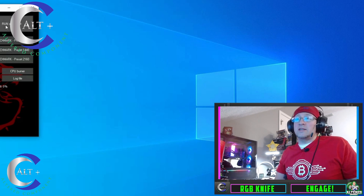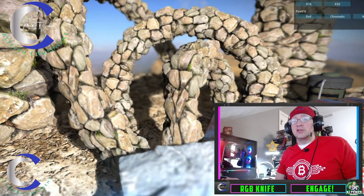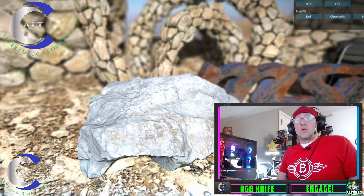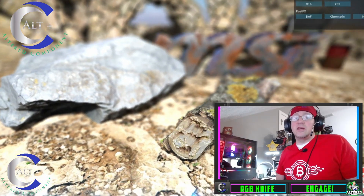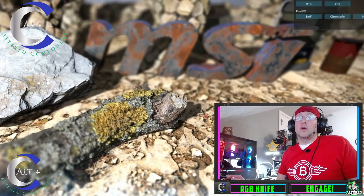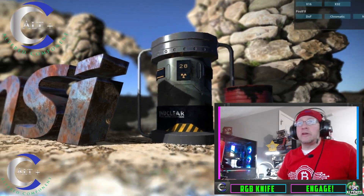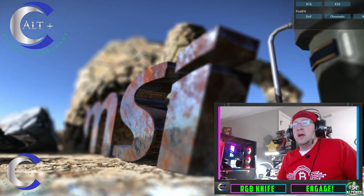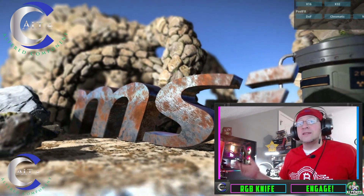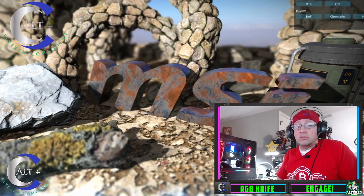We'll go ahead and run our stress test and let it go for a while. We're going to make sure we don't get any errors, artifacts, or crazy temperature spikes. MSI Afterburner would help manage temperatures for gaming, but we're just going to let the software dictate temps and watch the fans ramp up properly. It's been running and it's staying around 73 to 74°C — pretty toasty — running about 75 to 76 FPS and staying around 235 Watts at the wall. Everything seems to be working really well. Next we'll test it on mining and then cut out for our conclusion.